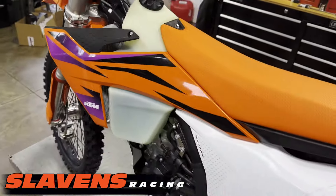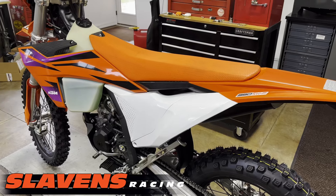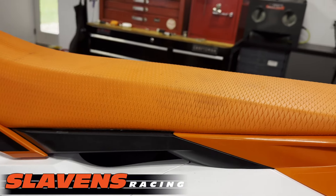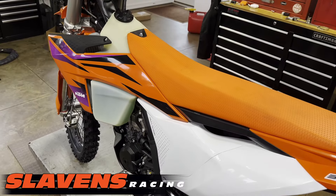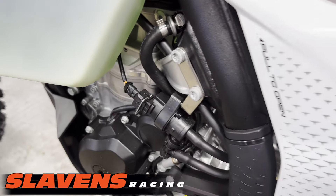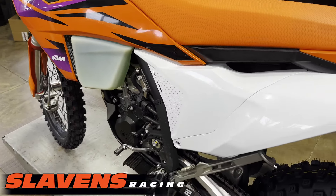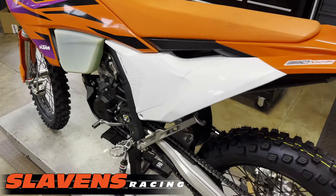As far as new changes for the 24, the bodywork is different. The rear fender, side panels, and shrouds are all different — they're the same as the 23 XC and SX models. It's got this new handle right here that you can lift the bike up with. I don't like it; it's in the wrong location — it needs to be farther back so you get better leverage. It's also got minor emissions equipment: that piece right there collects and sends vapors from the fuel tank to a charcoal canister. That does nothing for performance — it doesn't degrade or help it. You can take that off with no consequences, and they come with a removal kit for that, including a little dongle in the kit that comes with the bike.